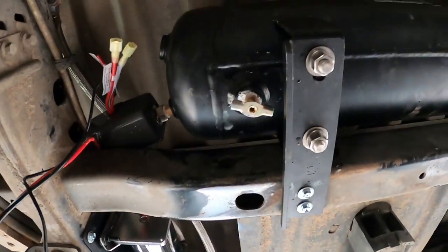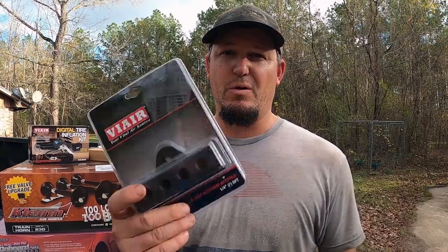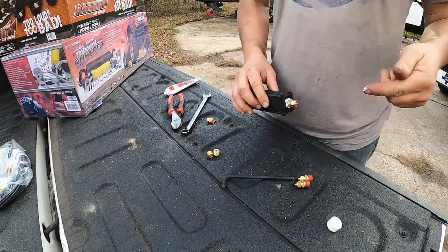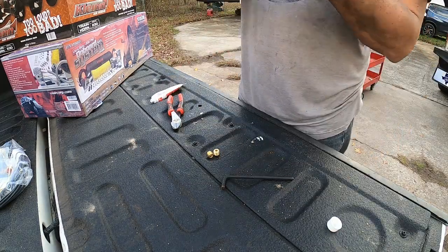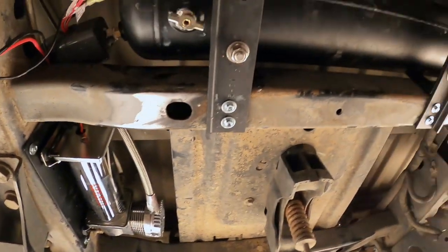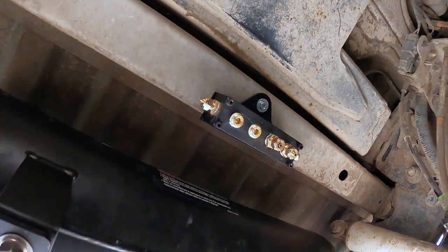There's our air compressor and there's our air tank. Now we're going to install our manifold. Our air system only allows for two ports, and since we're going to be running a remote air chuck, the train horn, and a remote filling station for our airbags, we got this manifold from ViAir. There's our air tank with the manifold on this cross brace, the air compressor on the side of the frame rail, and the air manifold on the bottom of this cross brace on the bed.